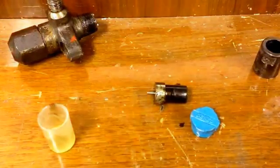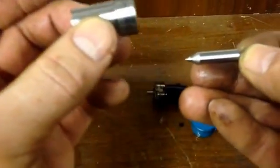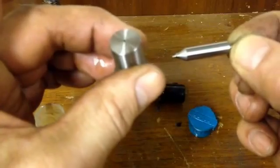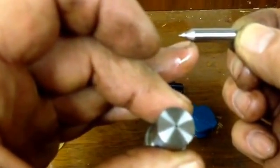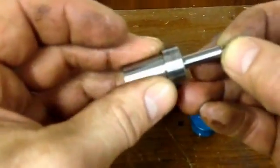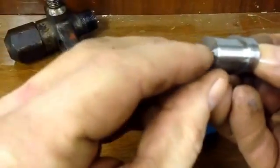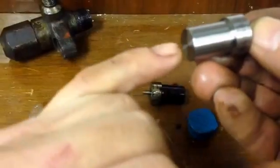Let's have a look at how these work. This is called the pintle — this little piece here. You can see it's got a sharp end on it, and that little sharp end blocks that tiny little hole. The pressure of the diesel being pushed in by the injector pump acts on this shoulder here — because it's quite a big area — and pushes it away, which then lets the diesel inject out. So a couple of things that can happen: first, it doesn't seat properly, and when the engine fires the pressure from firing blows bits of carbon back up in here, which makes the pintle stick.